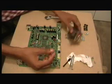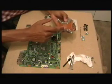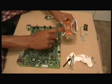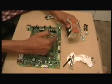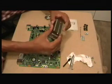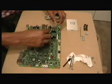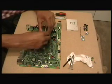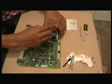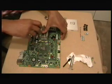Now we're going to take our first heat sink. There's no need to scrape the thermal paste off the bottom — it's not really going to matter. You may watch some videos that tell you to scrape thermal paste off the heat sink and the motherboard, but trust me, it really doesn't make much difference at all. So basically we're going to take the heat sink, place it onto the chip, and take our flathead screwdriver and make sure all of the screws are on pretty tight, because you don't want any loose screws.